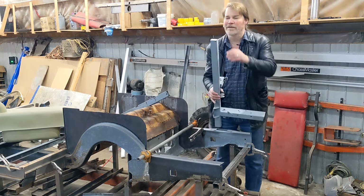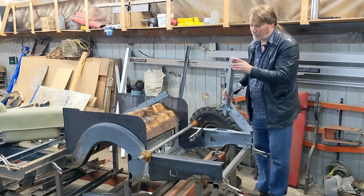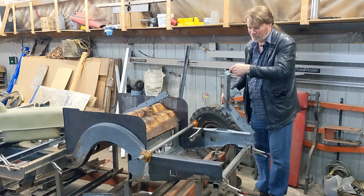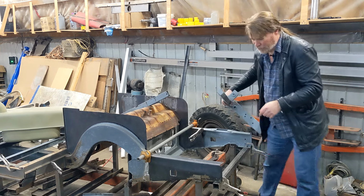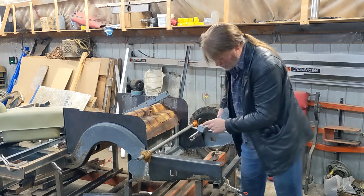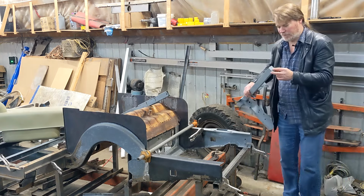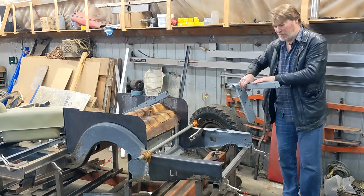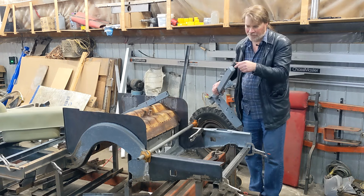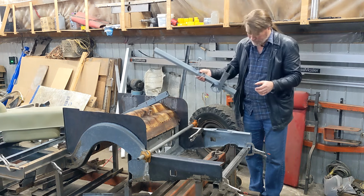And these have a cap on the end. Now, as far as I can tell, the cap was welded on at the same time the frame is welded in. So the frame extends through the side frame rails, and then it's welded from the outside. The cap is only 20 gauge steel, whereas this is like 16 gauge. And it looks like they welded it all at the same time, because it only looked like one bead of weld all the way around, burning everything together. Well, at least that's the way I'm going to do it.